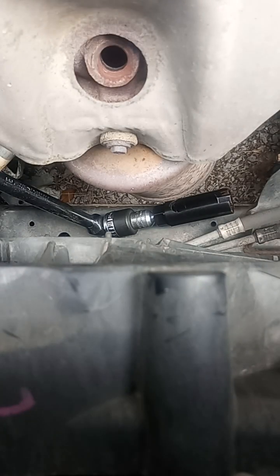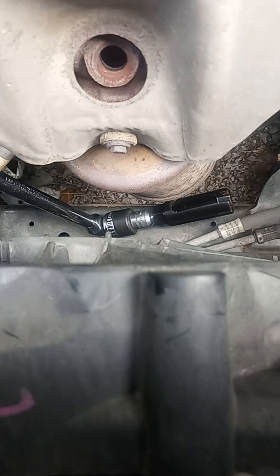I'm going to put a light coating of anti-seize on the threads. You do not need a lot of this stuff. It's Teflon-based, so it tends to spread really well when you get it on the threads and start threading things together. It also tends to spread all over your skin if you get any on your body — you'll look like the Tin Man from Wizard of Oz — so definitely use some care when applying it.